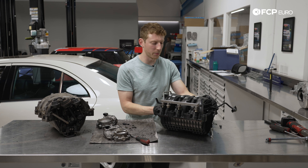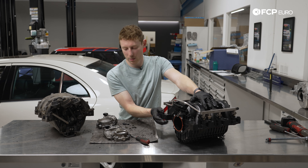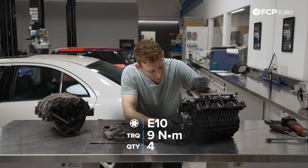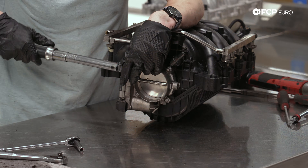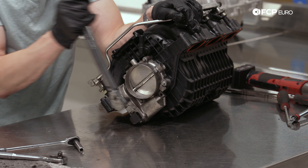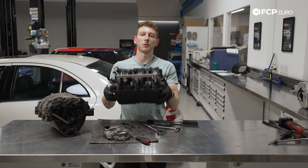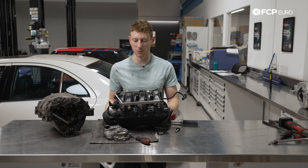I'm going to extract the little piece of plastic that broke off the secondary air pump vacuum line — that can just pop directly into place. Now it is time to do the throttle body. We're going to be cutting our own threads on the inserts here. Bolt it down and torque to 9 Newton meters. We have our M014 manifold put together, throttle body bolted on and torqued to 9 Newton meters — this is ready to go back into the car.